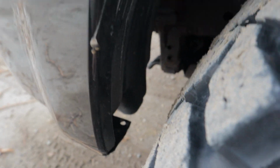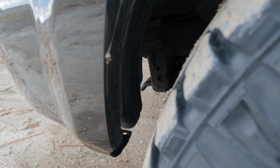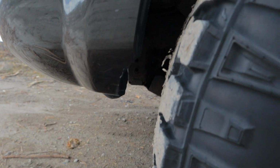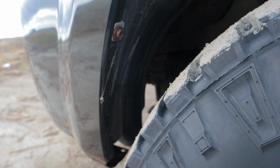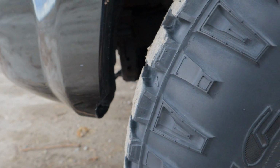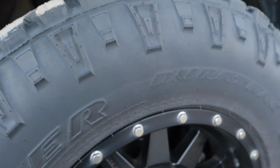You can see, I don't know if you can get in there, I also moved the inner fender liner forward. I moved it forward probably about 5 inches or something. I drilled some new holes and used the original mounting hardware to remount it, but that gained a whole bunch of space up front. And between that and trimming the corner of the bumper itself, that got me the clearance that I needed. At full lock, I'm not rubbing.